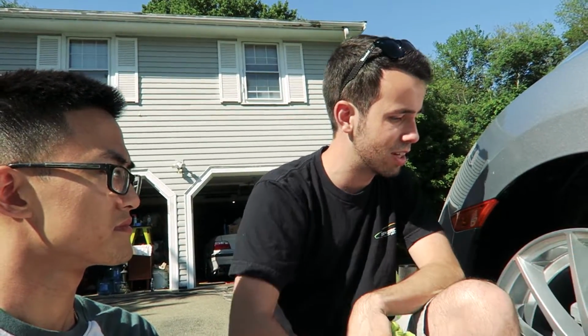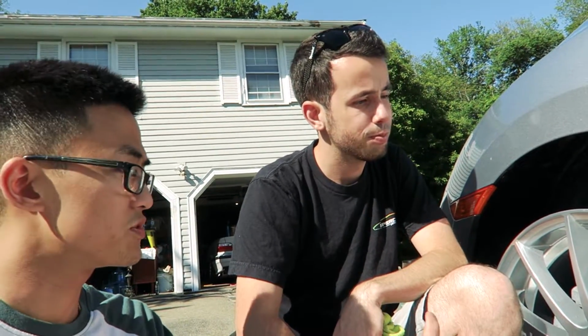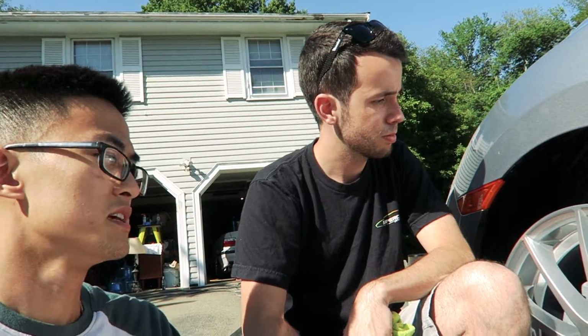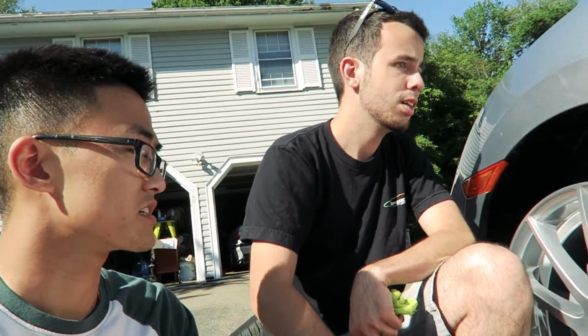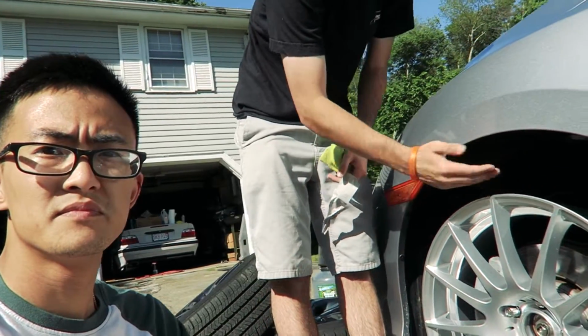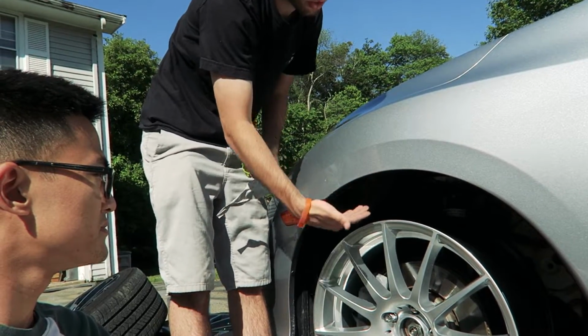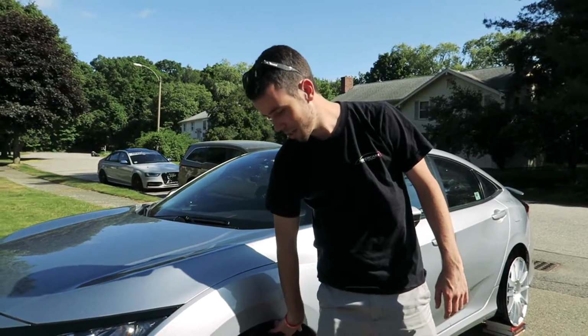It's an aggressive wheel fitment, a 35 offset and an 8.5. But people have run it before, which is why I chose this offset, so it's really nice to see that it does in fact look like it's gonna fit. I mean, it sits pretty flush here, so as long as you get a tire that rolls over a little bit, it should be able to tuck in as the wheel comes up, and the car's gonna naturally camber itself in as well. This is my worry right here.